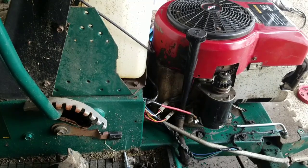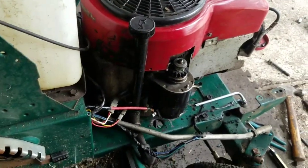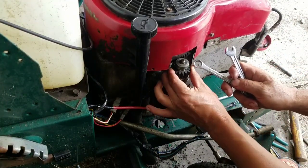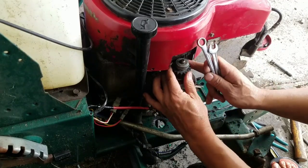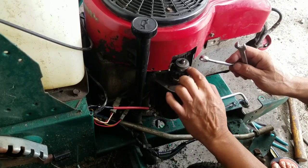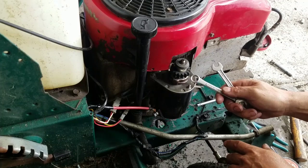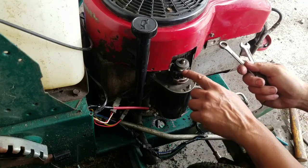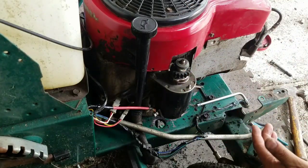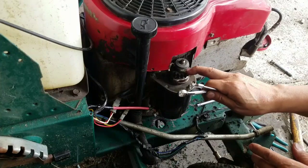So this starter I rebuilt a while back, right? And while I knew that after I rebuilt it, it would work, I thought the mechanism here, the ring gear, felt really hard to turn. You know what I mean? The plastic was gouged there, and I tried to smooth it out, but it's just not right. It has to be super smooth. So unfortunately, I think the inner plastic shaft sleeve, it has a groove in a spiraling screw kind of mold. It's kind of off track. It's dented and twisted and all that stuff. So it's not in good shape.